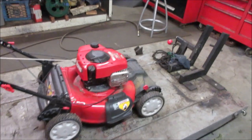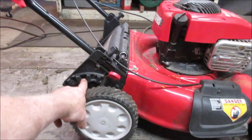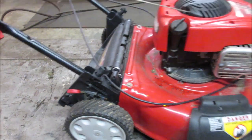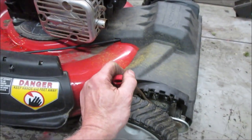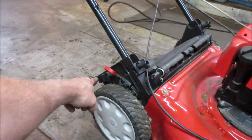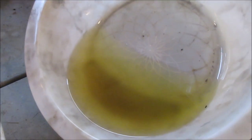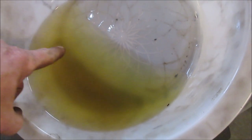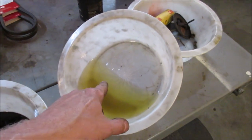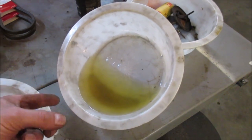Whatever grass we're trying to cut was fairly high — that's at the top setting, about five inches of grass height. Generally I shoot for about the middle setting on the wheels. Let's go set the front one right about there and do the middle on the front one too. Sometimes that stuff gets bound up if it's never been moved. Looking at the old fuel and oil — on the gas you can see that darker area down below is all water, probably a good inch of it. That's definitely what was causing it not to run. They probably had that in there, left it outside over the season, then poured fresh gas over the top of it, tried starting it, it wouldn't go, and that was the outcome.